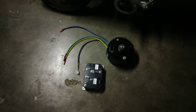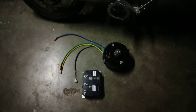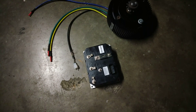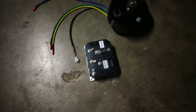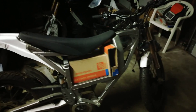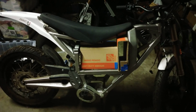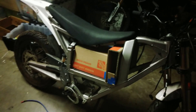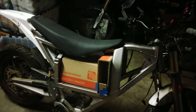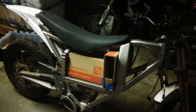When my friend bought this bike, he also bought the Golden Motor kit that came with a 72-volt, 300-amp Golden Motor controller. That controller might cause a problem because it's 72 volts and I want to run this bike at 48. The battery compartment isn't big enough to run a decently long-range, high-voltage pack. It's kind of a trade-off — you either get high voltage or you get longer range.